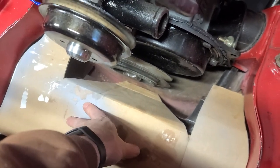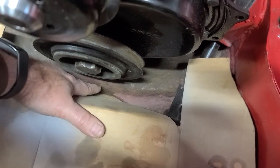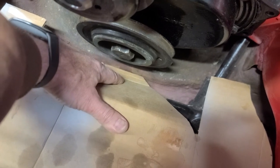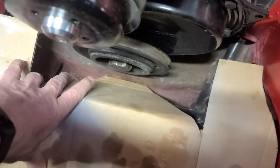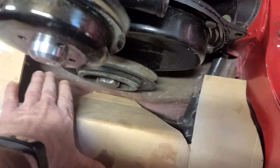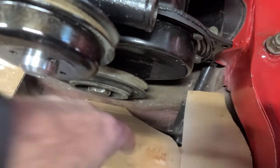The way this works is it has this little flap, and that flap is supposed to go all the way down — there's a little hole right here where a screw goes through and connects the flap. And from this flat surface to this flat surface, there's kind of like a chin guard that goes down and gets connected here to protect the harmonic balancer. So there are two pieces — this is going to be a two-piece template. We'll go ahead and start cutting the metal, lay it in there, and then take a measurement for this chin strap piece that closes this triangle gap here.